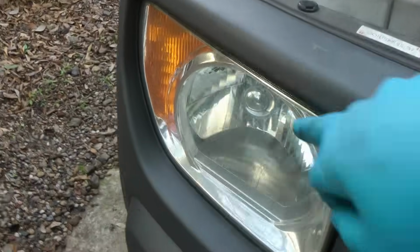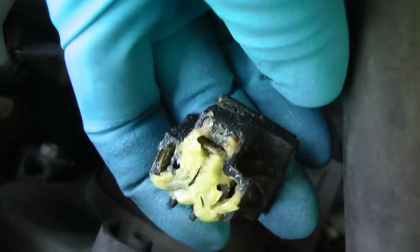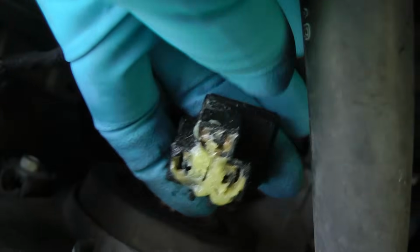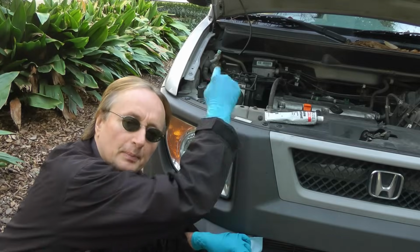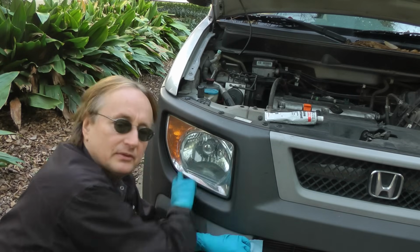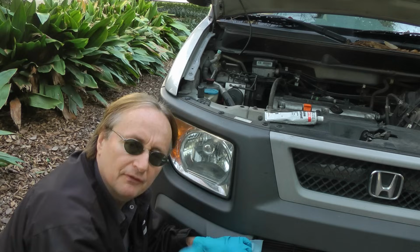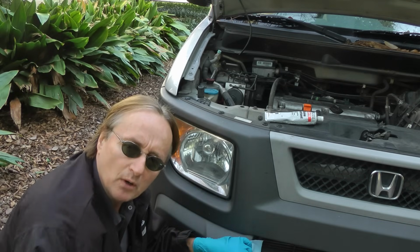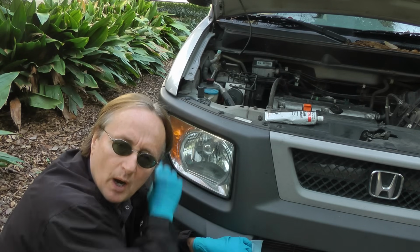And another use is for light bulbs. When we go to the back, where the light bulb plugs in, you put the grease here because they get awful hot on these modern high-intensity light bulbs. Over the years, I've had to replace lots of connectors, and sometimes even the whole headlight assembly. It gets so hot from the heat that it melts stuff. When you put this on, you won't get that heat because there won't be corrosion, and the corrosion won't be able to make the wires hot.